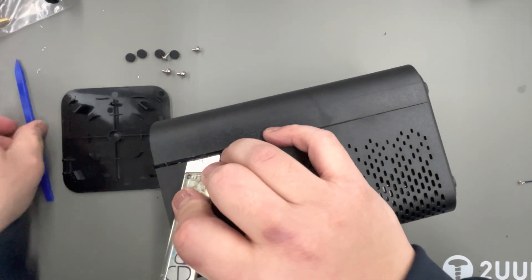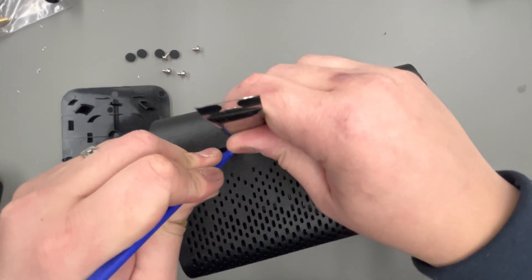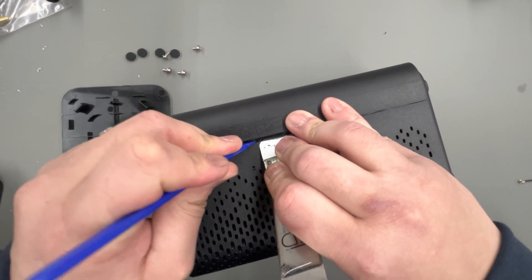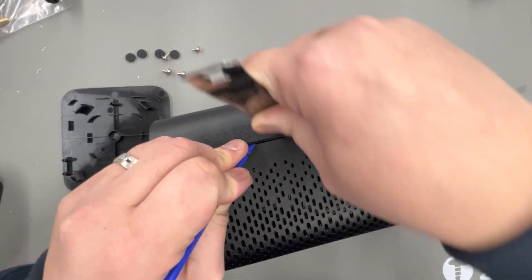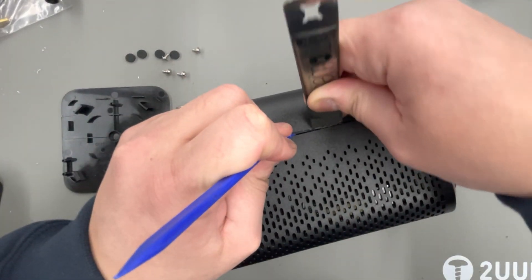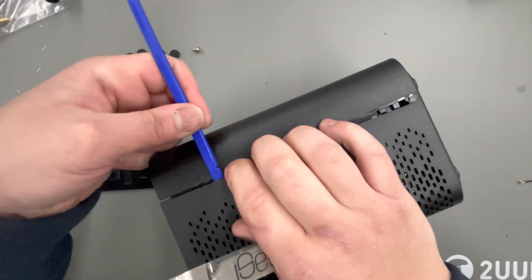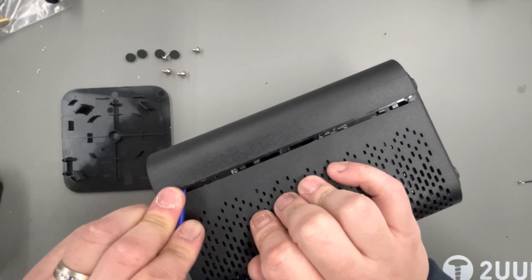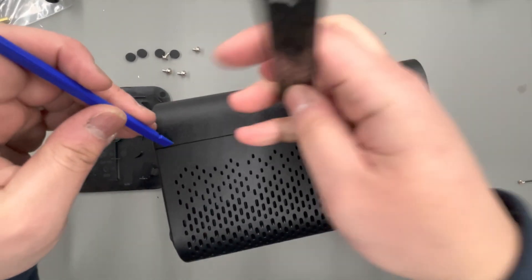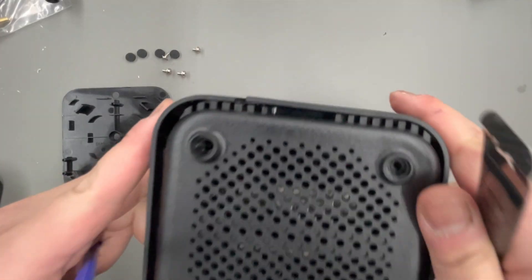All these tools are nickel and dime — we're talking maybe five bucks each. You can probably get a five-pack of plastic spudgers for like six dollars. You just have to wedge it in there; you're not really prying, you're more like creating space. As you create that space the tabs start to separate. This device was provided for free with the service, so I kind of want to save the plastic. Once you've got one side slightly separated, move on to the other side — it comes right off pretty quickly.